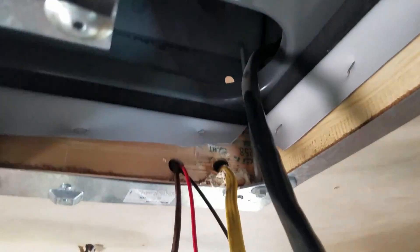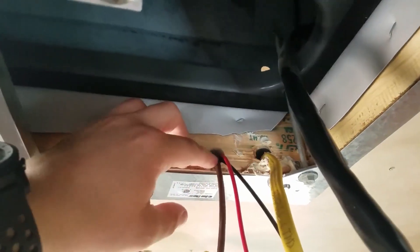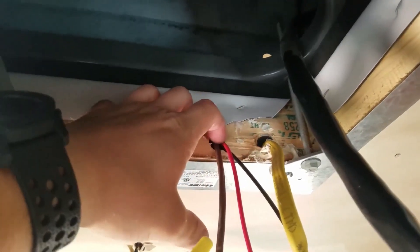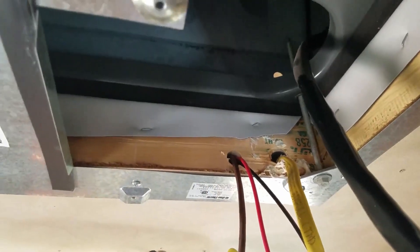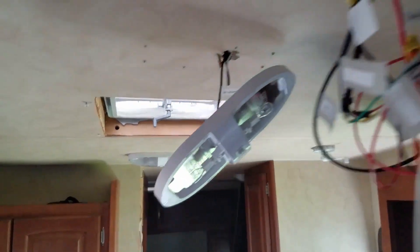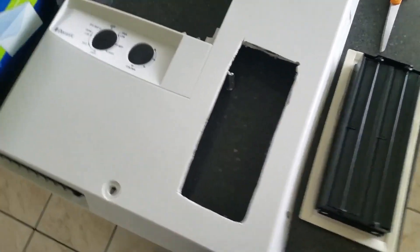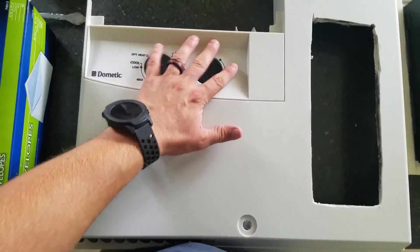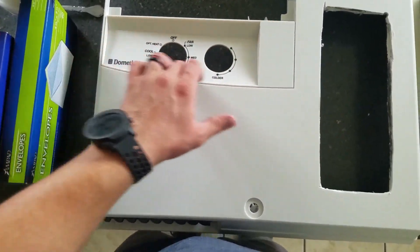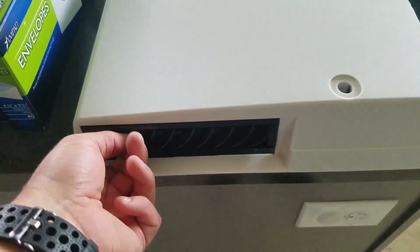Now that we know everything is functioning correctly, we're going to start paying attention to the little details. These holes that we had to drill — one was from the factory but this one we drilled — we need to fill these in with some foam or caulking to keep that cold air where it needs to be going. Same thing with the hole we drilled on the other side. Another thing I'm modifying is the actual airbox — I'm going to have to cover this up, probably with some white vinyl to get a cleaner look since these controls won't be here anymore.